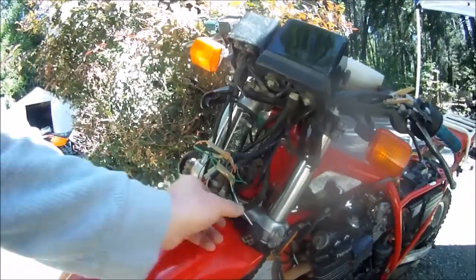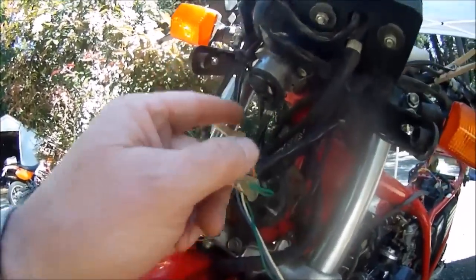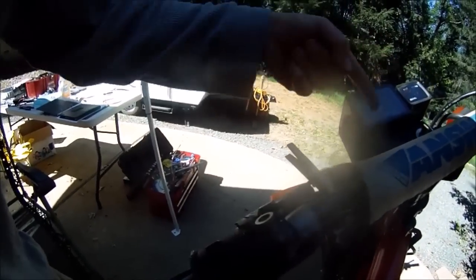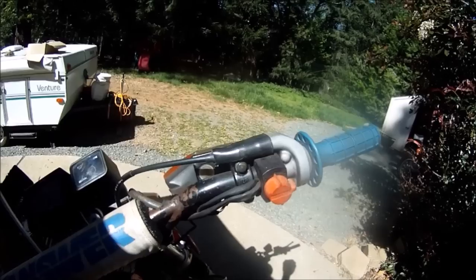Here is your rear brake light switch. Working forward, I've taken the headlight off so I can troubleshoot up here. Here's your headlight plug, and you've got your 12 volts going to your horn. Then you've got wiring coming up to the ignition harness, splitting off for backlighting of the speedometer, turn signal indicator, high beam indicator, neutral indicator, two turn signals, and splits off to go through these switches for your high and low beam, left and right turn signals, horn switch, and a kill switch over here, which opens the ground for the ignition circuit, killing the bike.